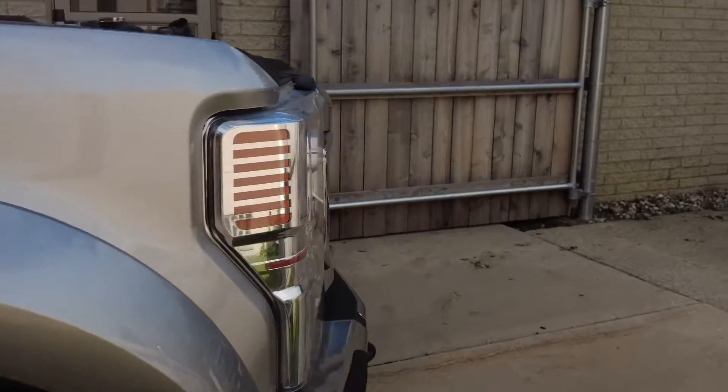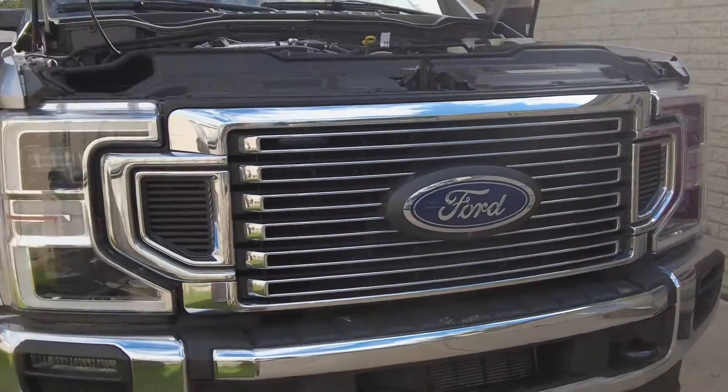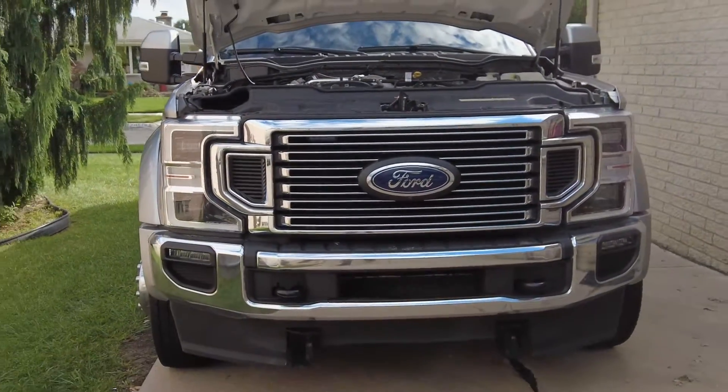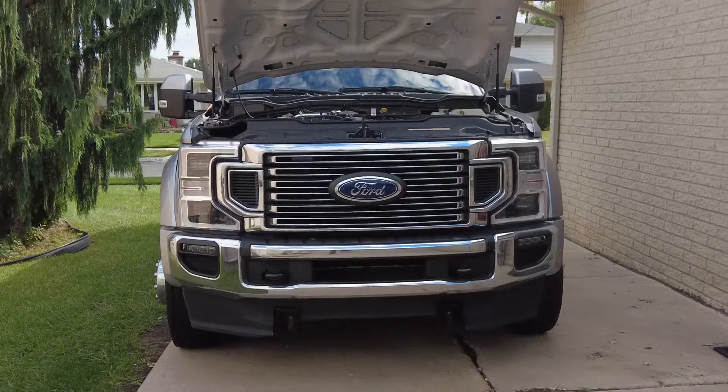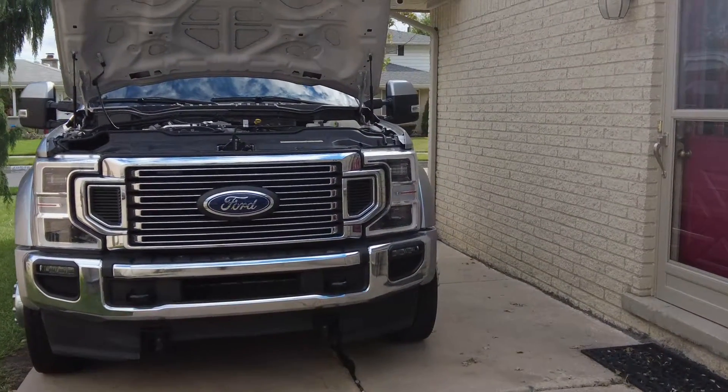The filter fills up with soot and it burns it off into ash, some kind of particle that you can't see. All that black stuff that comes out of the exhaust pipe is the soot — it gets stuck in a big ceramic filter, and then it gets burned off using extra fuel.